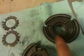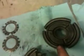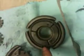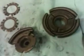That's it. And you can also use the second gear clutch hubs off of an A3. They're the same clutch shoes, so if you buy a whole clutch, then that's an extra set of pads if you ever wear these down or need another set. That's all.